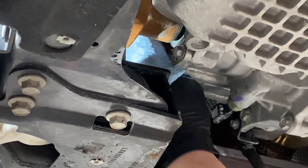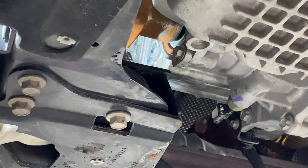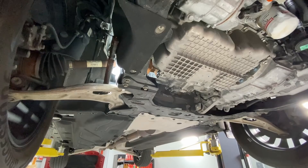Clean it up, and our fill plug and drain plug are good to go. We're filled with fluid — time to put the shield back on, and that is all there is to it. Change the fluid every 30,000 miles. This will save the PTU from self-destruction — I see it all the time on older ones. With this PTU having both a fill and drain plug that are very easy to access, there's no reason not to get in there and maintain your vehicle. That's all for now — see you guys next time.